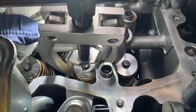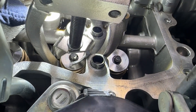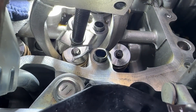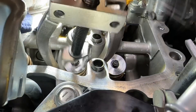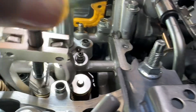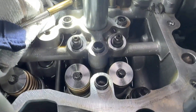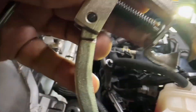This is the last of the spring collets going on. All done. I'm loosening the spring compressed — collets are pushed in — then I carefully loosen the overhead compressor. The biggest risk is the fingers letting go and the whole thing jumping off before you get the collets in. Thankfully they're all done now. The springs are in — beautiful. I had to bastardize this tool massively to make it work.